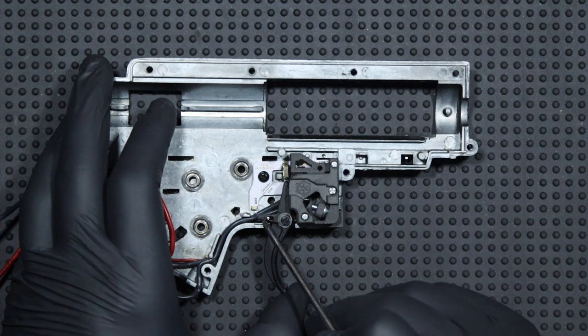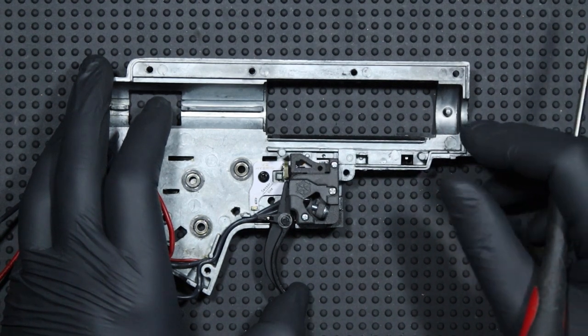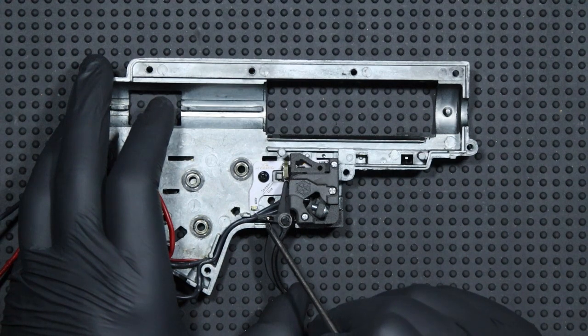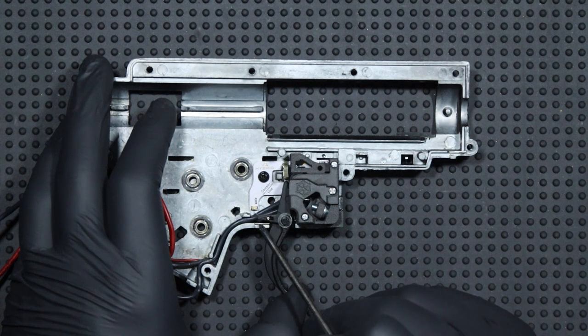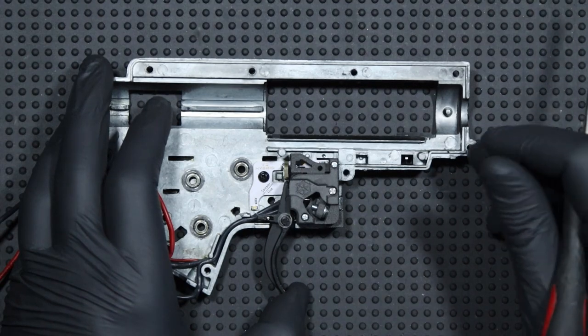But if you like to feel the resistance practically immediately, you can use an adjustable trigger or glue something here to shorten the path of the trigger to the clicker. It is important, however, that the trigger does not rest directly on the clicker in the rest position, but there is some slack, which ensures smooth operation and trigger reset.